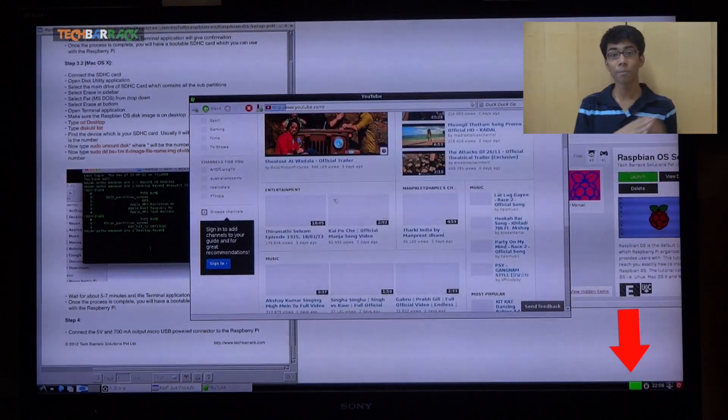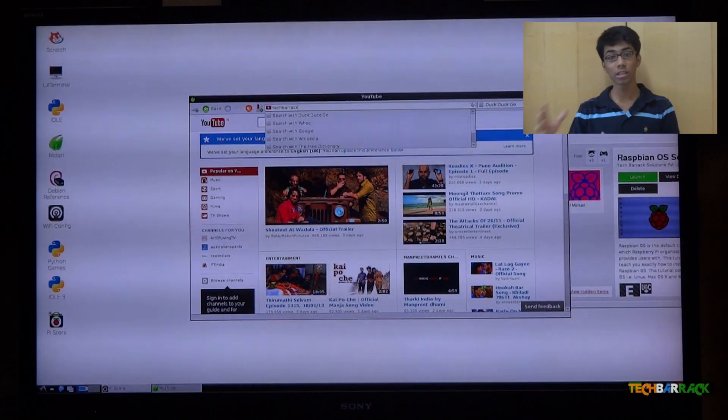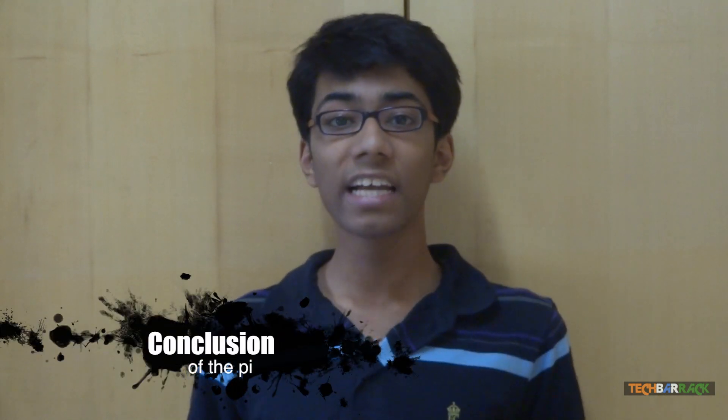Running multiple applications will instantly push CPU usage to 100%. The 512MB RAM is adequate, however the 256MB RAM is not sufficient, so the Model B is recommended. The processor performance is poor for desktop use. For macro photography, coffee machine automation, and other small task-based applications it performs great. Creating a web server is also poor due to inability to handle large traffic, but file sharing on a home network works really nicely.